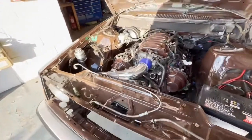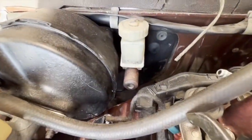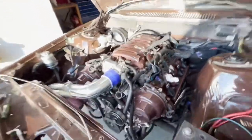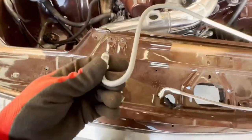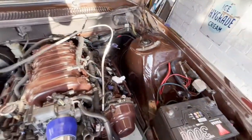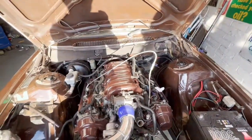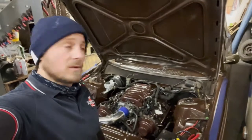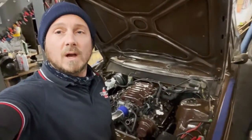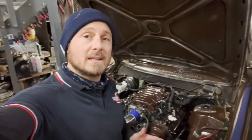You can see it was quite tight from the clutch slave, and I've got my new IS200 slave cylinder. I need to link the two in holy matrimony. I went to a local shop called Thread and Pipe who made me up a rigid line with a nice tight 180-degree bend that comes round into a flexi with a 90-degree fitting. I'm going to attach that to the bulkhead with P-clips and bleed it all up. Hard line is in, from the clutch master round to the flexi and down to the IS200 slave cylinder — but the pedal is rock hard.